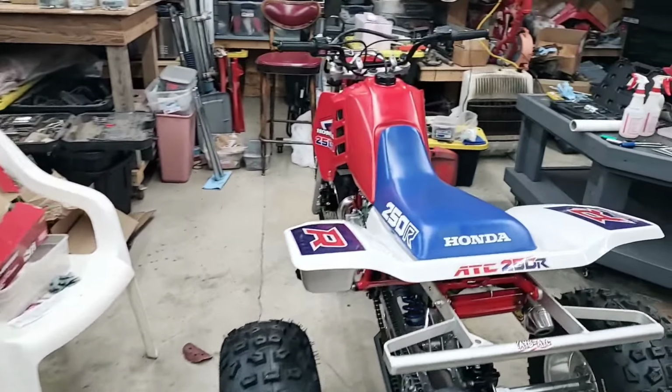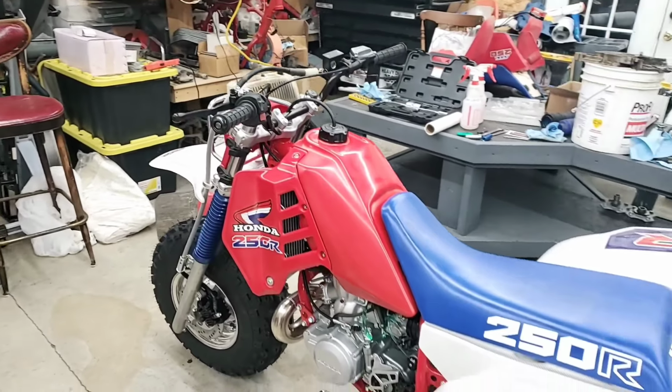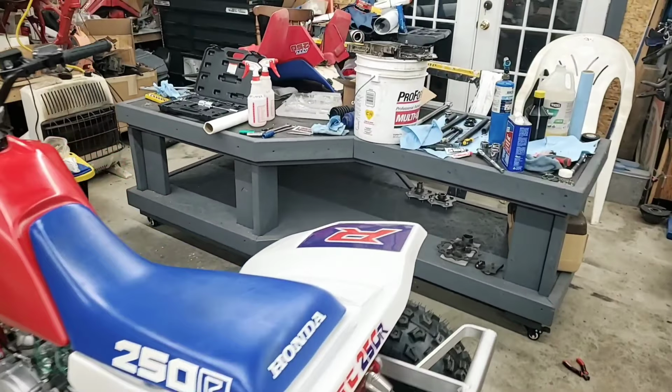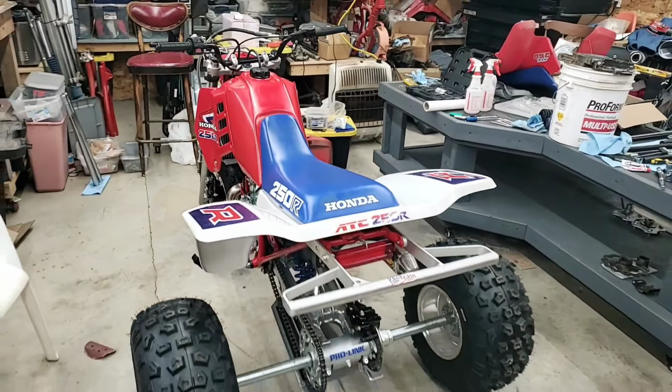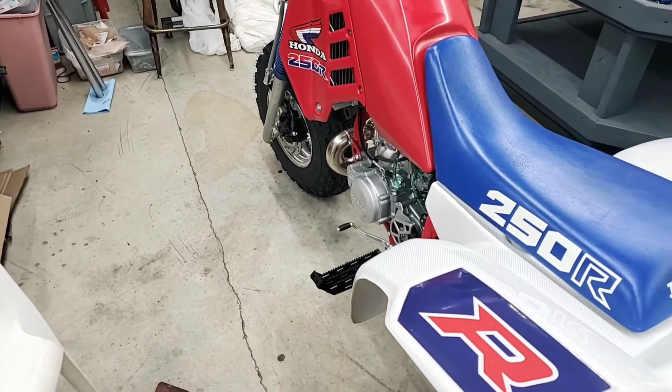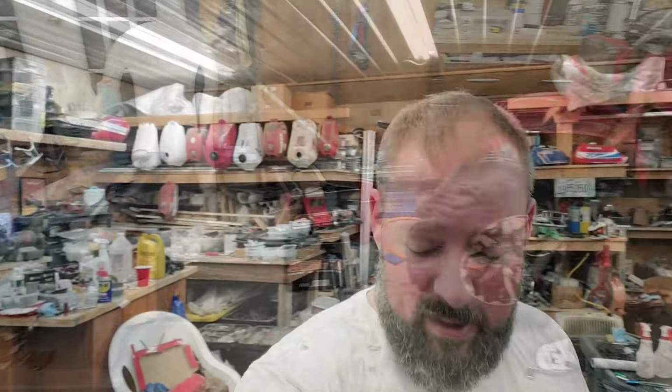And I got to do a little test with this to get it running just a little bit better. It's a little bit boggy at higher RPM. So once we get that at least a little bit more dialed and the skid plate from Noah put on, that'll be ready to load. So just trying to get my affairs in order after this. Got the fully suspended 200S previously owned by PJ Hart. Boy, that's a long name. I got a carburetor I want to try out on that. The 200S I'm bringing, I got a carburetor I got to try out on that, or at least clean that one. Pink Palomino needs attention.